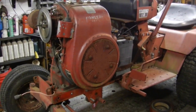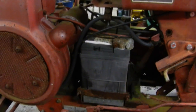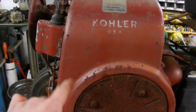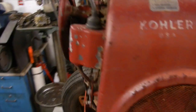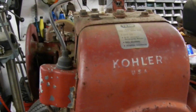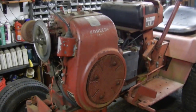We're going to be starting in on the 69 Charger 12 revamp today. To start things off we're going to be pulling out the battery to get a little extra room to work around the engine, and then we're going to be pulling all the shrouds off to check the trigger ignition system that rides against the flywheel, because those have been known to fail. Depending on whether it's good or not is going to depict whether I'll have to convert this over to points ignition or not, which I want to determine before we get the carburetor cleaned up — without spark there's no use doing that.